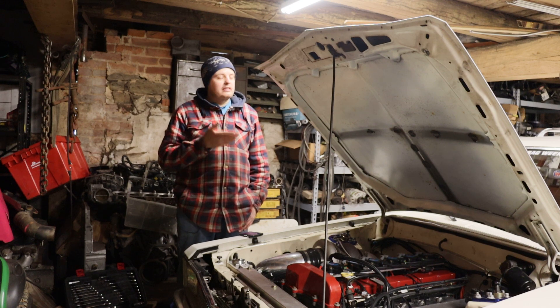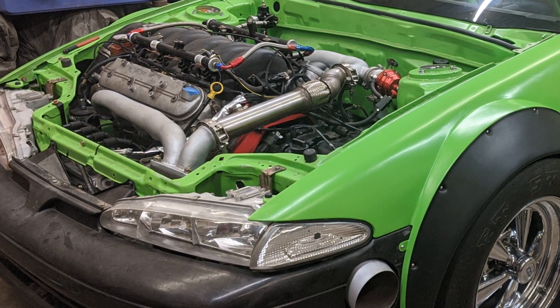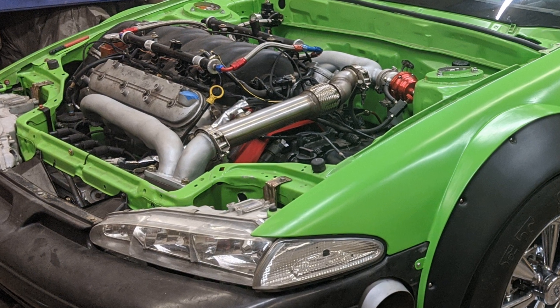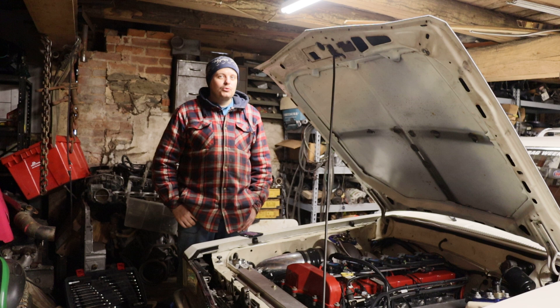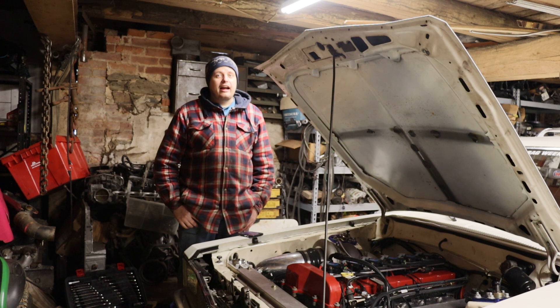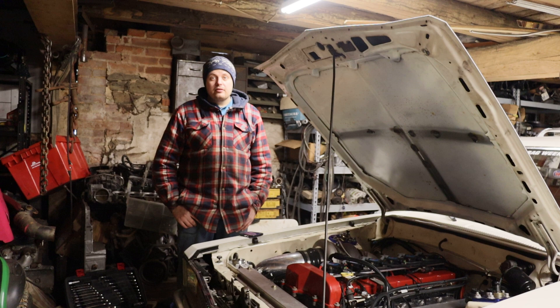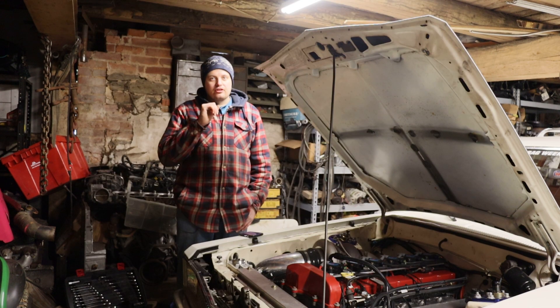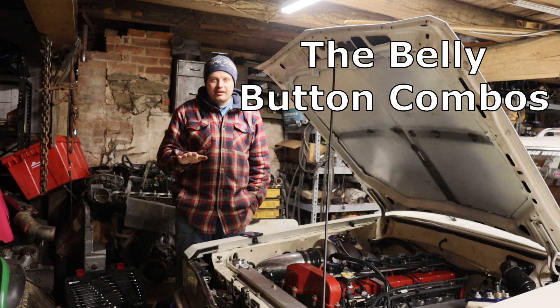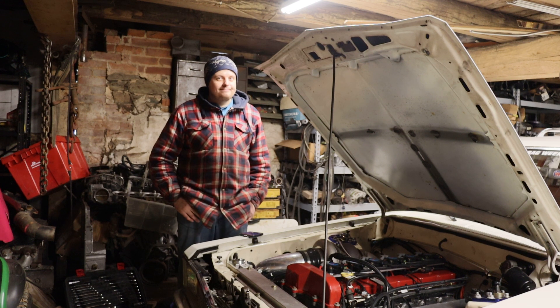A good example is the Eagle Talon we built with the front-wheel-drive 4T80E. We were having extremely harsh shifts. The factory modulates the transmission pressure control solenoid, and I wanted to do that with one of Holley's advanced tables, but they wouldn't let you. Which brings us to the Max ECU — it's the closest thing I've found to a microcontroller of any ECU I've ever used. Holley ECUs, for better or for worse, keep you from hurting yourself. They work great for basic setups: LS naturally aspirated stuff, HEMIs, basic turbo LS combos. But it's very common to run into scenarios where those basic controls just don't get the job done.